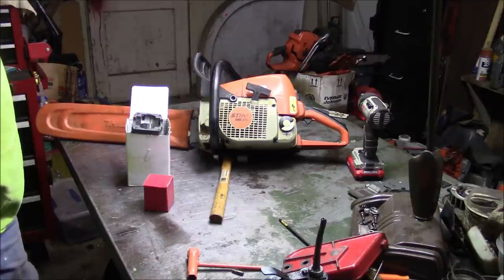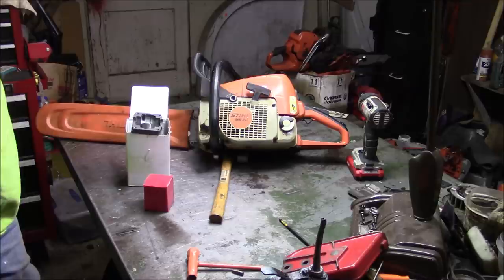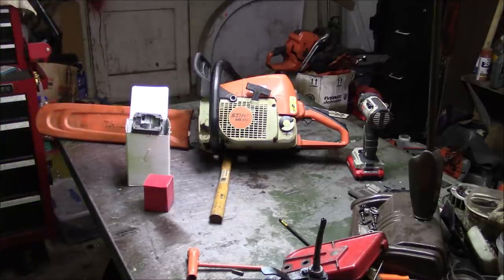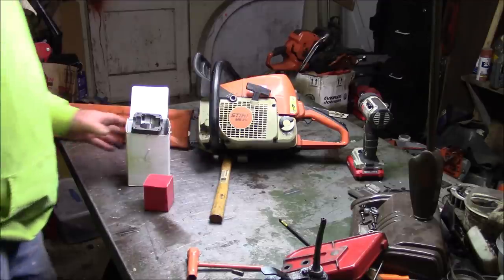It runs pretty good, you know? I think that's pretty impressive, starting from where it did with that big air leak and potentially issues with gaskets and things to where it is now. Actually, it's running a little fat. I have to start leaning it out, and that's quite a change from where it started, isn't it? And the more I run it, it seems like the better it gets. It's like breaking in yet again. It's picked up quite a bit of compression.